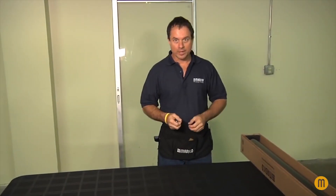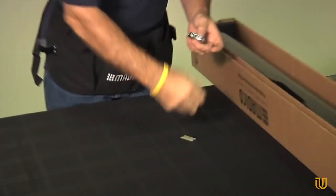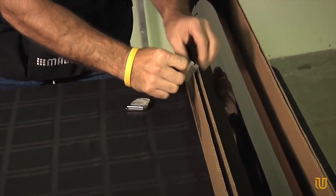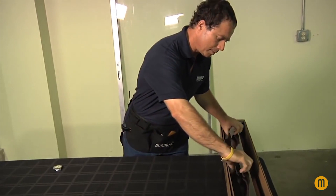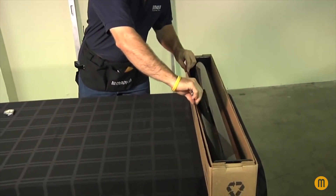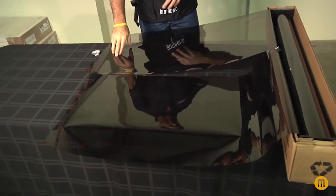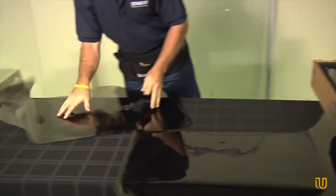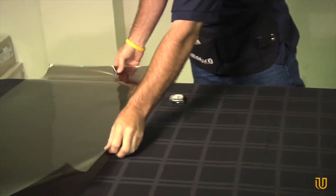For this install, we're going to be cutting off a 40-inch roll. Since we don't need a 40-inch roll for the side window, there's a little trick you can use — cut the roll in half. Take a razor blade, measure across the box 20 inches. Apply it in at a slight angle, make sure you get it in pretty good so it holds in place. Then measure out your length — about 34 inches. Lay down your tape measure so you can see where you need to stop. Get the film underneath the blade, slowly pull it up and out. Grab your knife, give it a cut, put it off to the side and do the same with the other. Then you have your two pieces of film cut for your two front doors.